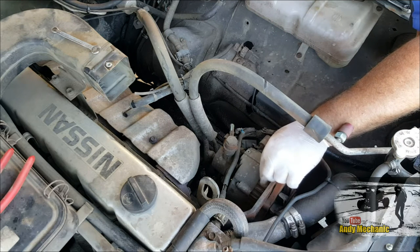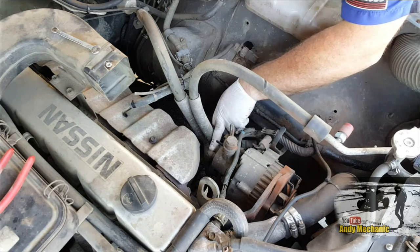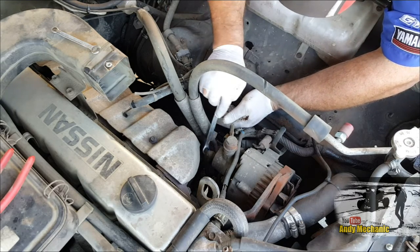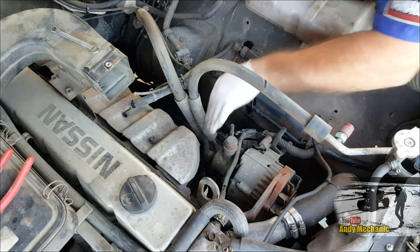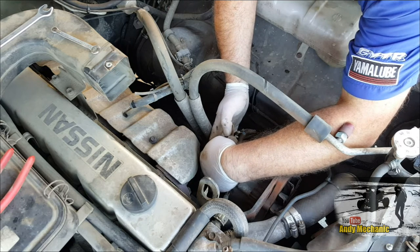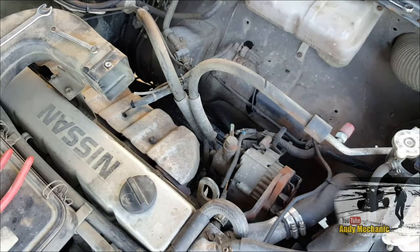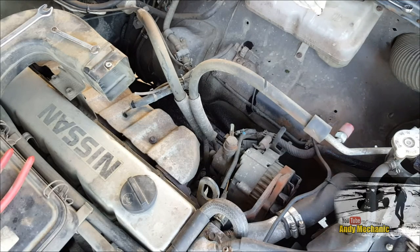There's one more thing we have to undo — there's a couple of oil pipes for the lubrication of that vacuum pump, which is this one here. So we've got to undo that, and that's also a 14. Now it's a banjo fitment, so you've got a couple of washers on there you don't want to lose. Now obviously with the alternator off and this oil feed pipe disconnected, you can't run the engine — otherwise you're going to spray oil all over the place. Diesel oil is pretty nasty stuff. That's one banjo bolt done — just got the washer to retrieve before it hits the floor.